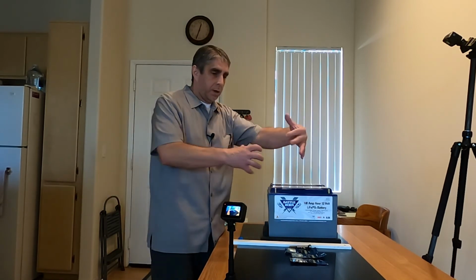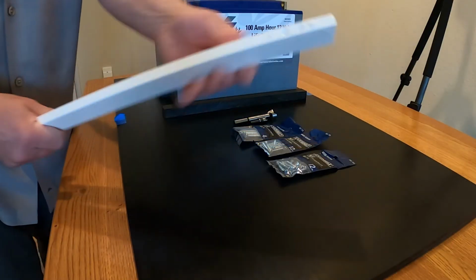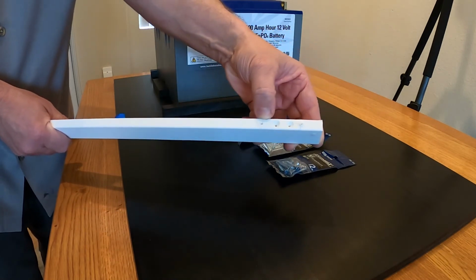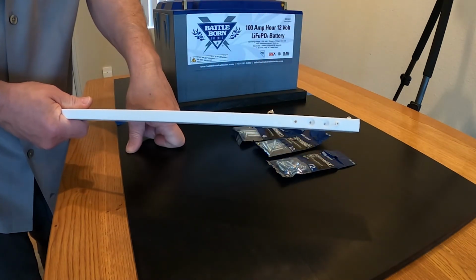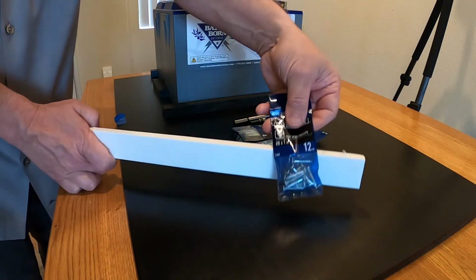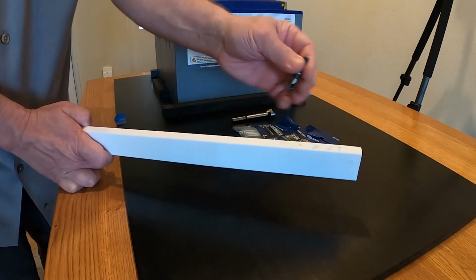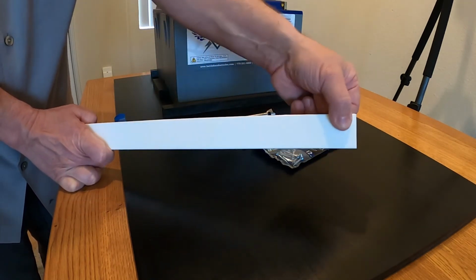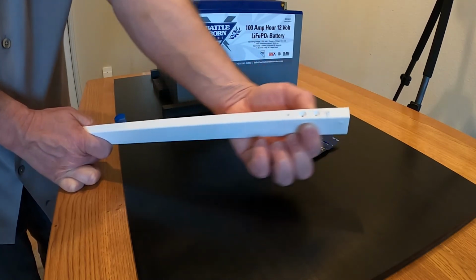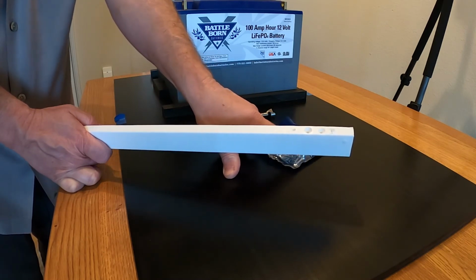In order for all these fantastic ideas to work, I'm going to have to connect all of these components together. I did some tests. This is the HDPE, and I drilled some pilot holes into this product from the side at this angle. And the idea here is I'm going to use basic wood screws. So for example, here is a number 8 wood screw. I drilled some pilots and went kind of small with my drill bit. And it seemed like if I went too small, it was separating the plastic and pushing it away. So the drill bit will be pretty close to the shank size of the screw.